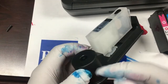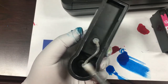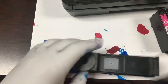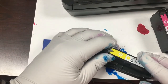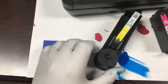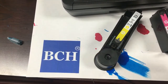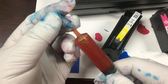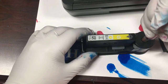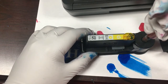The inside of a pedestal is very simple. For example, there's a U-shaped tube that connects the ink injection points to the cartridge. We put a yellow cartridge on the pedestal, then fill the syringe with ink. After that, we put an adapter on top of the syringe and add ink until it comes out.